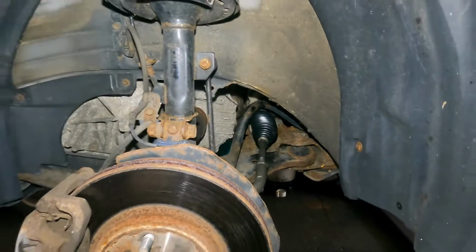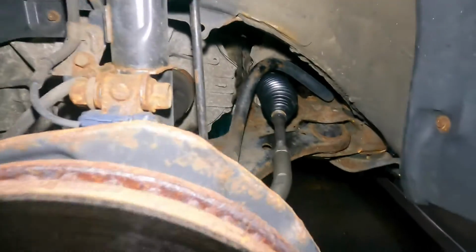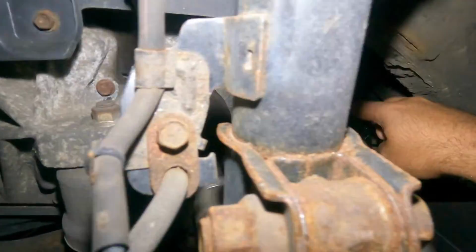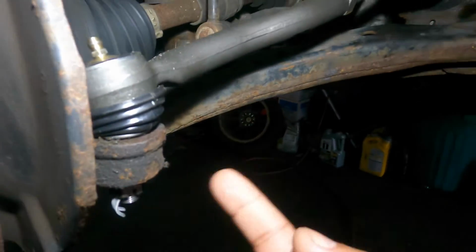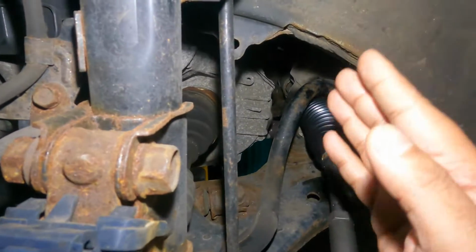All right guys, we got an 05 Toyota Avalon, and we're gonna replace our rack and pinion. We did tie rods, and then we discovered our rack and pinion was moving from the joints, the bolts. So the bushings are all gone. We're gonna remove this again. I got videos on all this. Remove this, remove this. We're gonna remove the linkage here so this can go up.